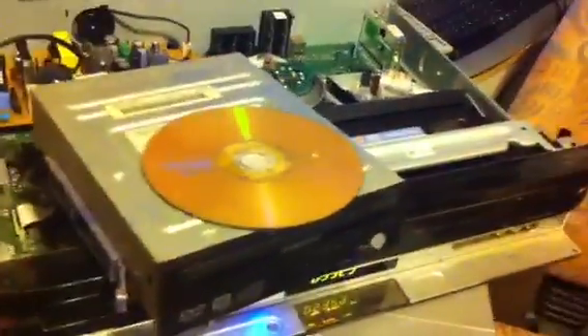Took the cover off, which is down there. If you look on the back of it, which is IDE. So I hunted down one of my computers that had an IDE burner in it. Basically, just had to put a jumper on it from Master because it wouldn't respond. As soon as I did that, hit the open button, she works fine.